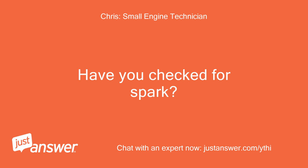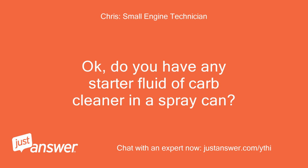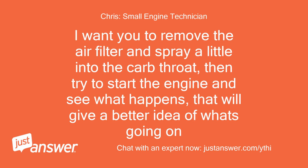Have you checked for spark? Yes, I have a spark. Okay, do you have any starter fluid or carb cleaner in a spray can? Sorry, starter fluid or carb cleaner? Yes, I've cleaned everything with it yesterday when I had it all taken apart. I ran out of it, the hardware store doesn't open for an hour. I want you to remove the air filter and spray a little into the carb throat, then try to start the engine and see what happens, that will give a better idea of what's going on.